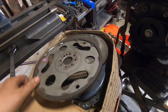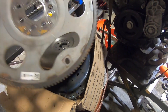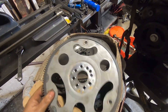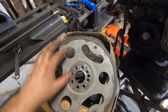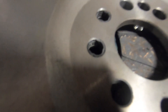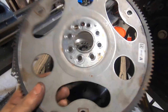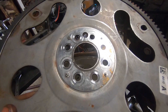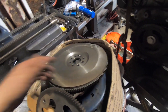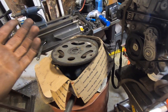It is the GM side that has the asymmetrical eight-bolt pattern. I don't know why — there are no features on the flex plate or the flywheel that say it has to go on one particular way. It will fit other ways. With these little rubber things taken out — I thought they were to hold the bolt in during assembly on an assembly line — the automatic flex plate does not have those and has much tighter holes, so the automatic flex plate may not fit numerous ways. But the stick shift one will, and the Subaru one fits as well.